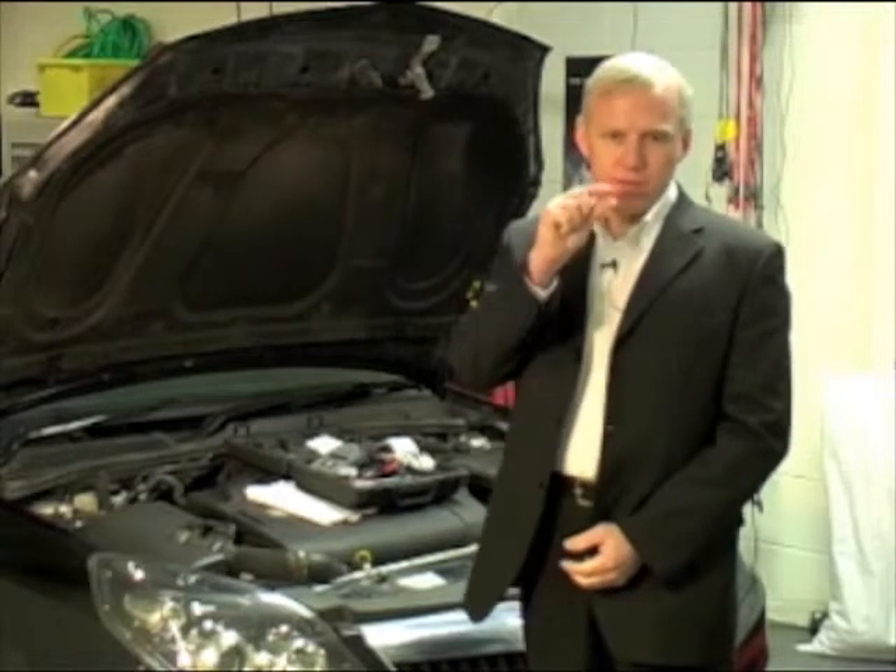So how does the moisture get into the car system? The microscopic pores in the rubber brake hoses and the breather holes in most master cylinder reservoir caps allow moisture to enter the system. Only 3% moisture in your system — that's a thimble full — can reduce the boiling point of your fluid to a point where under certain braking conditions the moisture in the brake fluid can boil and vaporize.